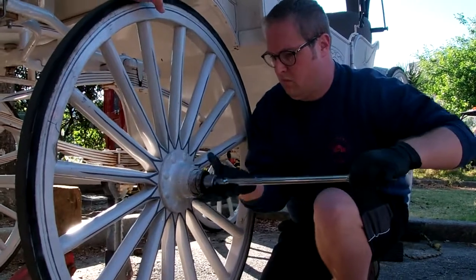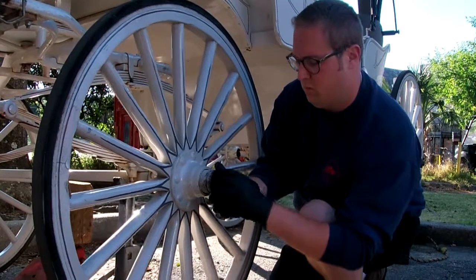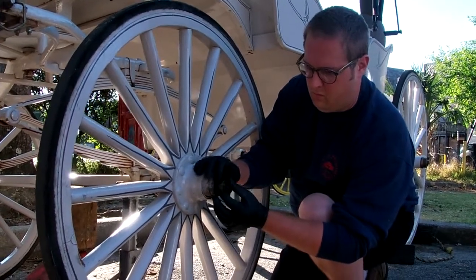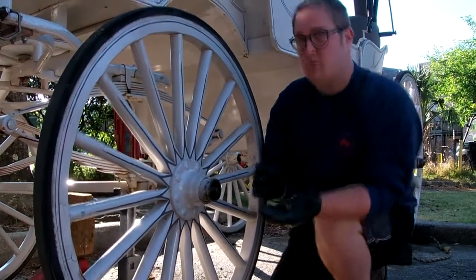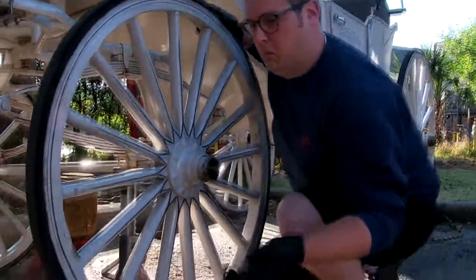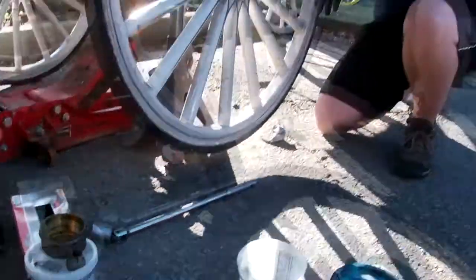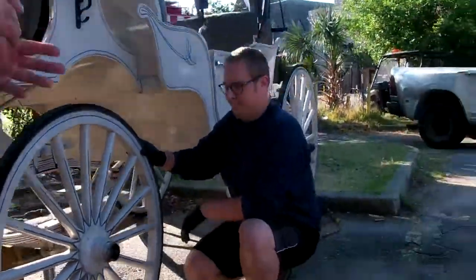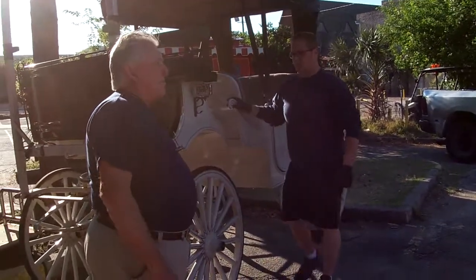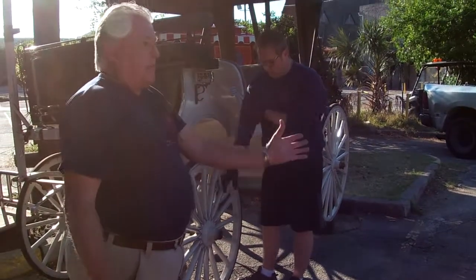Normally when you're doing a tour, if a bearing's bad, and I know you all have good ears, you're going to hear that bearing. It's going to growl. You're going to hear it, even though it's not going very fast. You're going to know there's a problem in that wheel, and you ought to be able to determine what wheel it is that's bad. And hopefully we will catch anything and correct that problem before it gets to that point, because we repack these bearings very frequently to keep the problem from happening on tour. Once that castle nut is off, that wheel will slide right off.